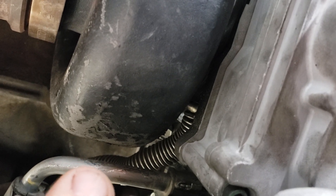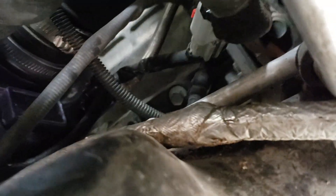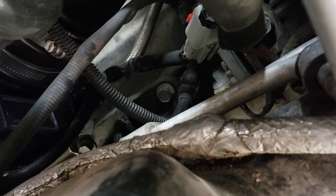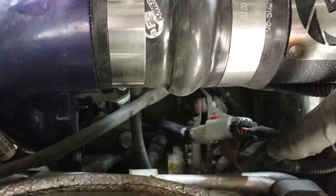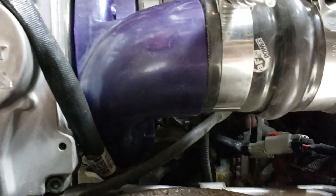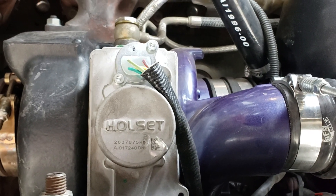There's also a return coolant line on the front side of this turbo. There's a return coolant line that goes into the block on the banjo bolt back there. By connecting both the oil drain and coolant return lines on the turbo first and then installing it, that seemed to be the best way. I tried it the other way and was not having success — after many attempts, it did work. These turbos are a direct replacement; I was beginning to think I got sold the wrong one. It's just really tight.